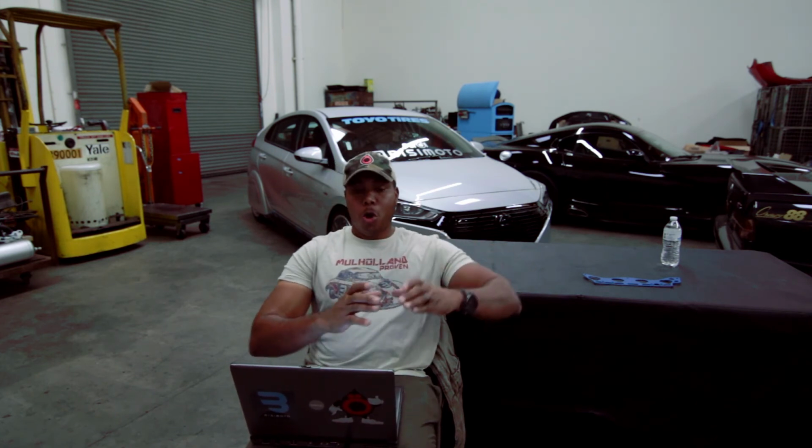You can have high spark energy and not have to drill into your head and put a second spark plug. And not have to worry about a twin setup in your distributor or large expensive multi-plug setup, which is pretty cool. So hopefully that answers your question properly. My experience has been nostalgia. Yeah, sure. Stay with the multi plugs in each cylinder, but you don't have to. You can definitely have some good spark energy and efficiency and power using a single high output coil per cylinder.